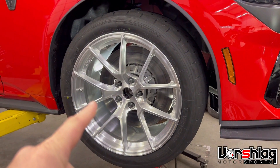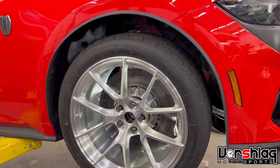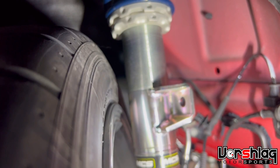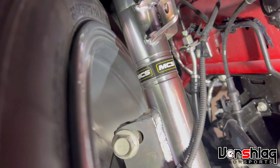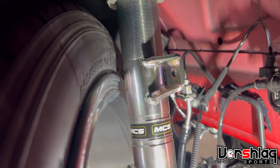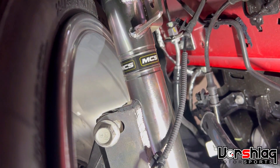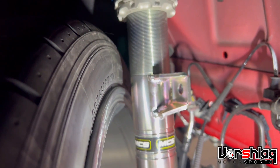We've got the rotor, wheel, and spacer back on — this is our widest wheel, the 1911 — so that's what we want to set and get as close as we can to the strut. We peek up in there and you can see the gap between the wheel and the strut. Brad can push it in or pull it out, changing that little adjustment right there. We'll get that until we have about two millimeters between the wheel and the strut, then lock it in. Once we tighten these bolts it won't move anymore because it's a spline bolt — that way we maximize our inboard wheel room.